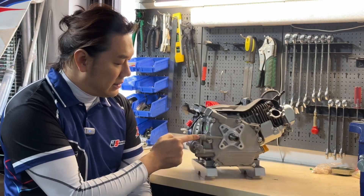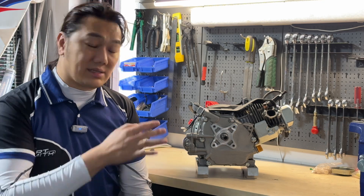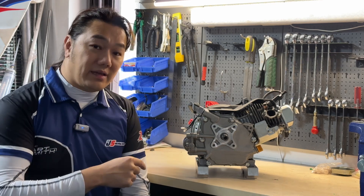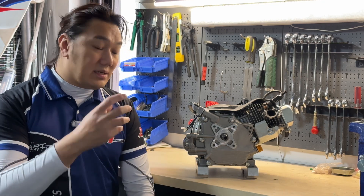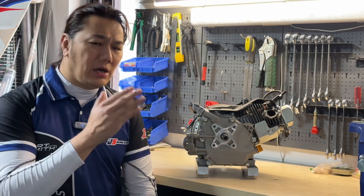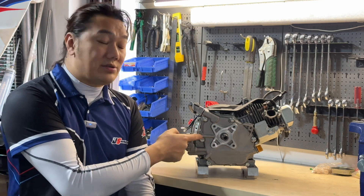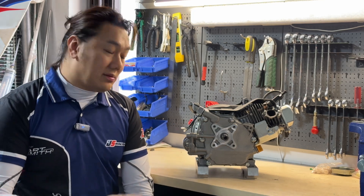The oil pump collects dirty oil, pumps it through a tube into the filter, and then pumps the clean oil back out through another tube that connects directly to the crankshaft. The crankshaft is the second completely custom-made component — it has a hole that connects to this tube and drives clean oil directly to where the connecting rod is. This provides the most direct lubrication possible. Normally, a typical build uses a scooping arm for splash lubrication, but the scoop is no longer needed here because there's a direct lubrication route from the tube to the crankshaft and connecting rod.